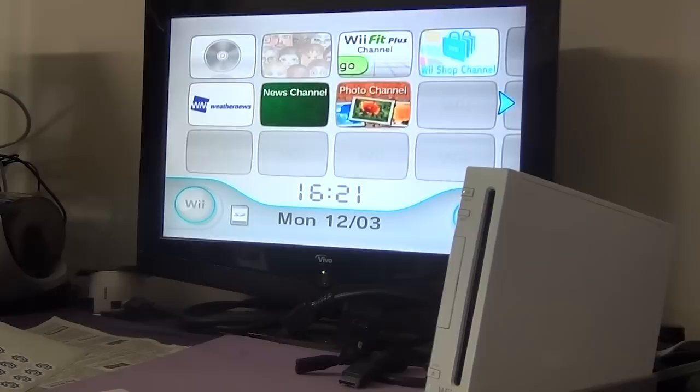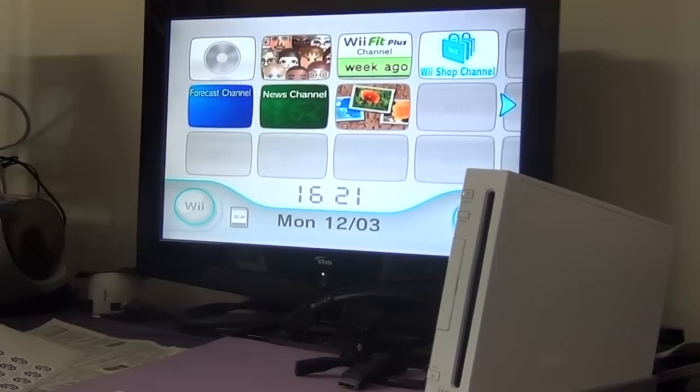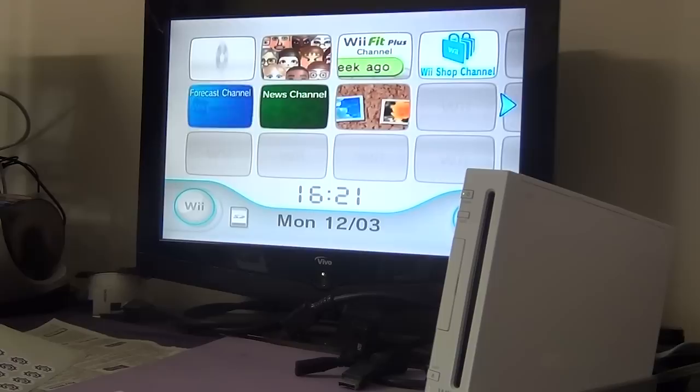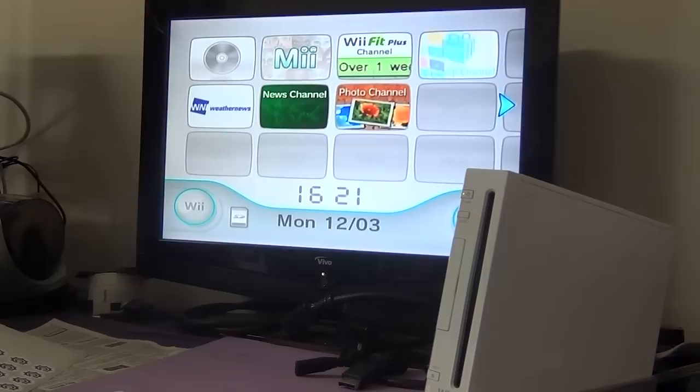Game console repairs. In this video I'll be going through a small analysis troubleshooting process of the Nintendo Wii DVD drive. The issue here is the Wii doesn't read DVD discs or Wii games. We'll be testing out four aspects of the Wii DVD drive. We'll test the insert feed mechanism, the Wii magnetic spindle motor, the laser movement assembly and the actual laser or lens module. Okay, let's test out all these four aspects one by one.